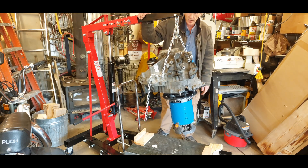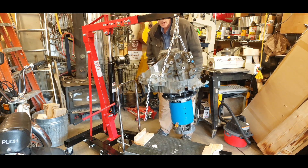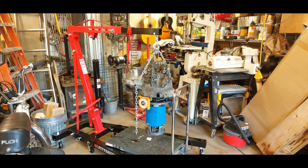My first estimate came pretty close to level but it's not really level. I'm going to try shortening by one link here and here and that should bring it close. She's up in the air and more or less level — I used that little magnet level and it's within a degree or two, which I think is adequate. I just want there to be no stress from gravity trying to move the motor one way or the other while I'm adjusting it. Next step is to loosen all the mounting bolts for the metal plate to the transaxle, then hook it up to power and get to tapping.